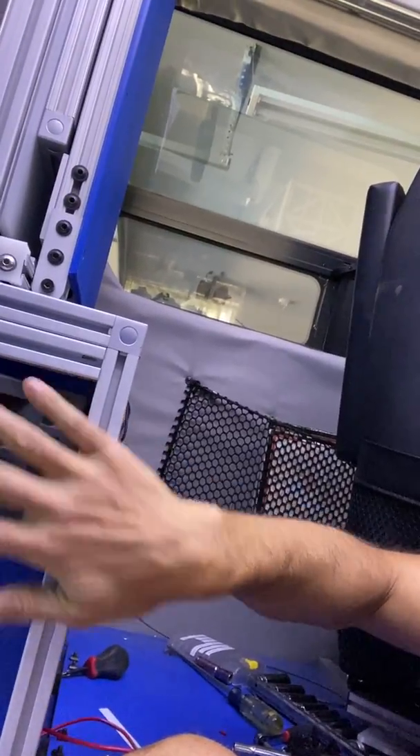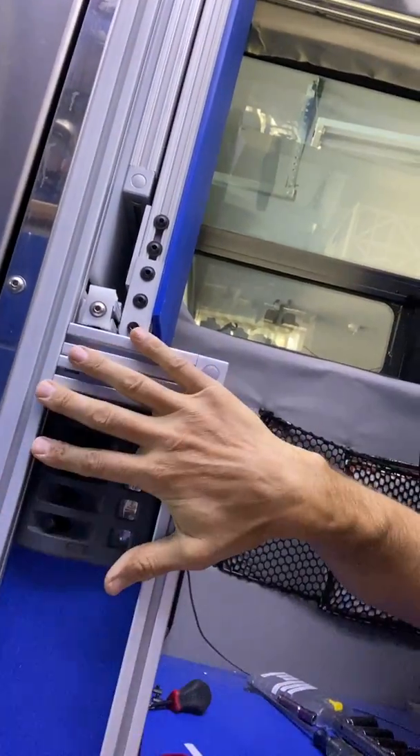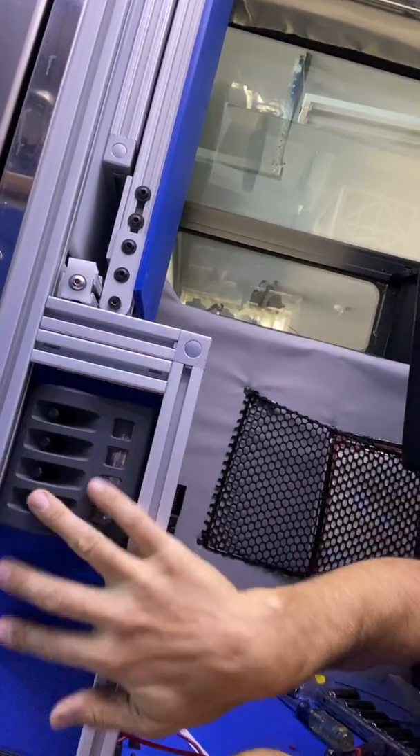I'll show a little more once I get it all wired up and changed out. This panel here was intentionally recessed so the switches don't get bumped when you walk by, but I don't really like all this aluminum facing being totally exposed, so I'm just going to go right over it with my new panel — particularly since I'm not going to have any switches in there. I'm just going to keep my night light here. I have a night lighting circuit with night lights in a few different spots around the van — low to the ground and low in luminosity — just enough to see where you're walking without anything blinding your eyes.